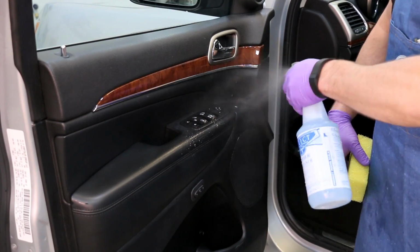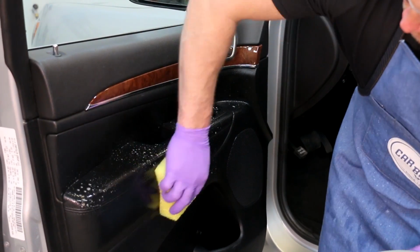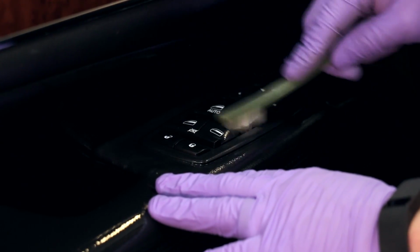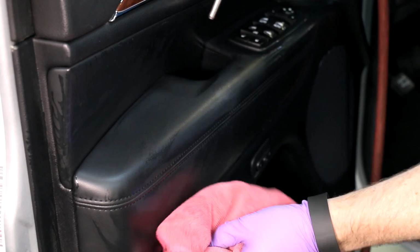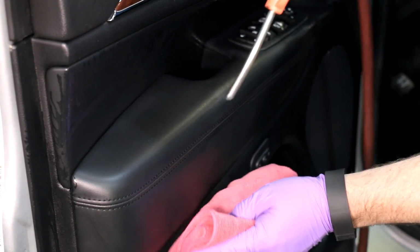Spray interior cleaner on hard interior door surfaces, not allowing it to dry or dwell longer than 2 minutes. Agitate with a do-all pad or detailing tools that have been saturated with interior cleaner. Dry the areas cleaned by blowing the excess solution into a towel with an air hose and wipe the surfaces thoroughly. Using air to dry only helps remove debris possibly missed.